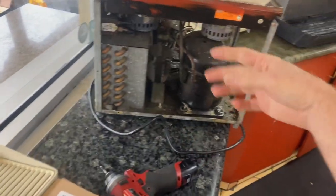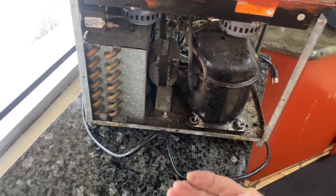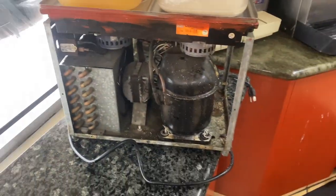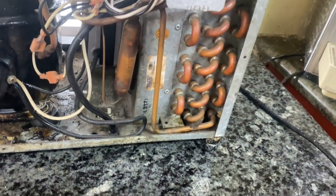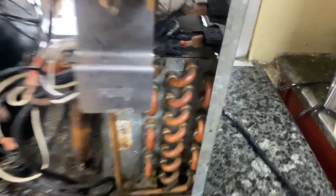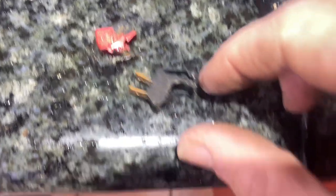When you get all the fronts and sides off, you can see the motor — you're going to take the two base plate bolts off and the motor comes out on this side. The other side has the liquid line, dryer, cap tube, and wires in the way for the condenser fan motor. This bottom switch is the one that failed. She's a leaker — the switch just fell apart as I took it out. Just gone.